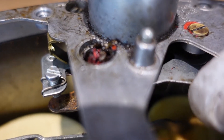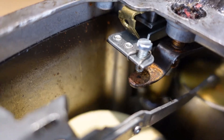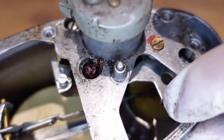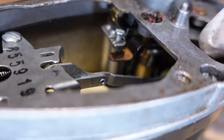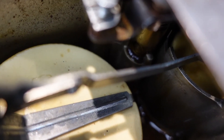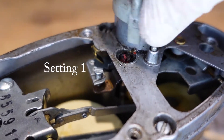For the high flame decrease, it determines how far up this plate goes — if we unscrew it, this is going to allow it to travel higher. The higher it goes, the more the orifice opens up. So essentially your whole oil stove adjustment is to control how low and how high this plate goes, and this plate is directly connected to the orifice — you can see it open and close. This plate is adjusted by the knob, so pay close attention when I turn the knob — watch that whole plate move down and back up.